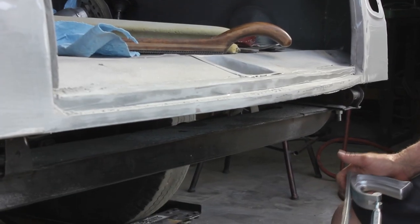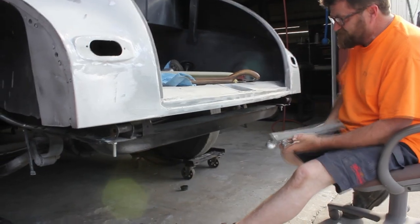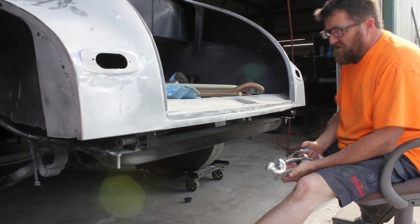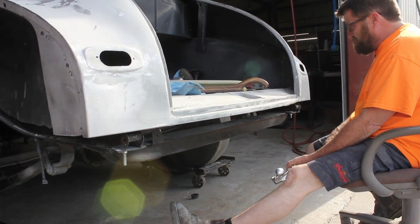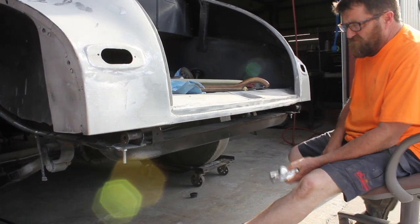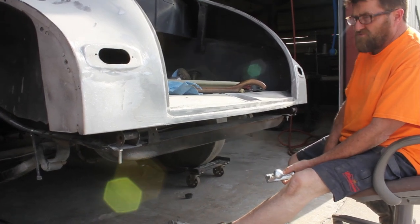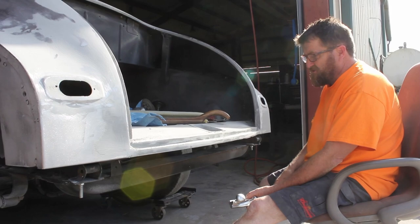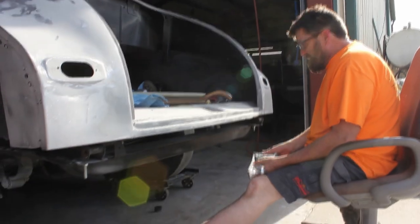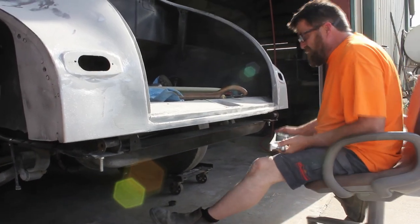Lead sands good in a metal file. Lead will bond up and get flakes of material in between the gaps, and you tap on the lead file and pop them out. This material is very, very similar to lead — very good to sand, hard as anything, but very, very durable and shapeable, and very strong. The thing is, it will not shrink over time and it'll bond and flow with the metal like lead does. Regular body putty shrinks over time as all the chemical dries up and goes out of it, but this one won't do that.